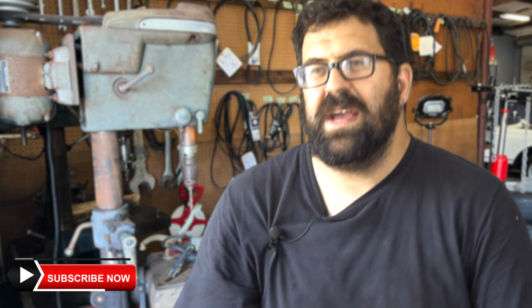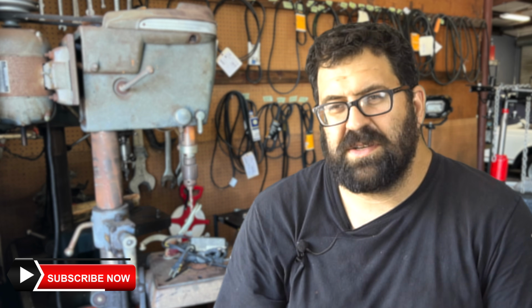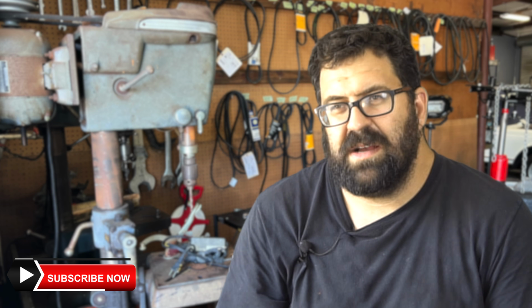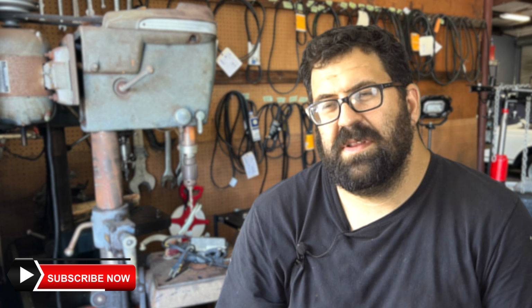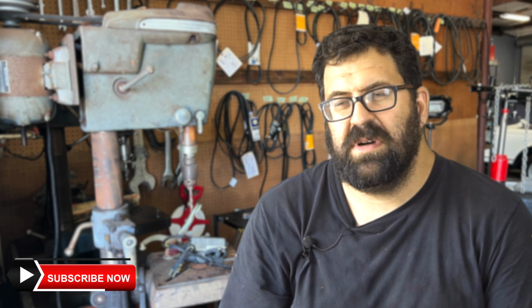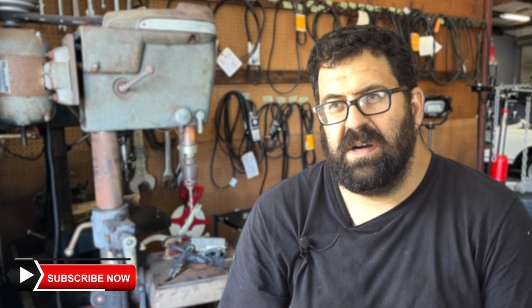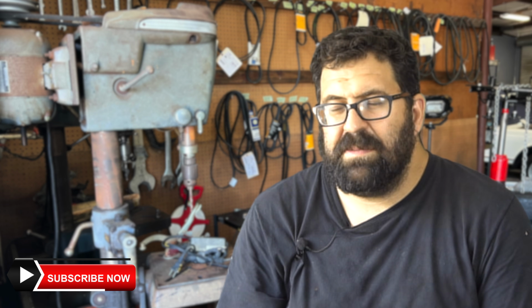Now, does this sound a little advanced? Well, yeah, there's going to be some content on this channel that's going to be above some people's heads, and I'm probably going to get the talk in the comments about how come you don't do simpler things. Well, because this is actually a big problem for those of us that want to resolve these issues, who have cars like 280 SLs or any Fintail car that is points, or a Ponton, or an early 115 series car, especially cars that have the cast iron 051 distributor. It's a good idea to understand what happens with these breaker plates.